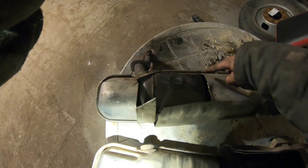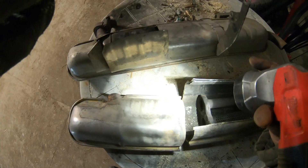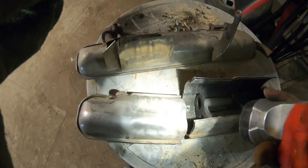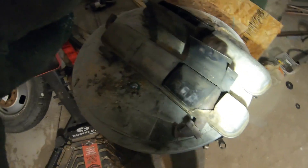You gotta cut it there and then it goes right to the very end. There are three bumps there — that's where they squished it to keep it in place until they welded it and to keep it tight in there. So right where that indent starts, that's where you give it a cut. That'll be at the end of it. And to get that cartridge out you gotta cut it all the way around.